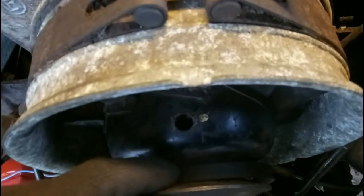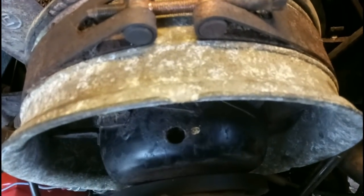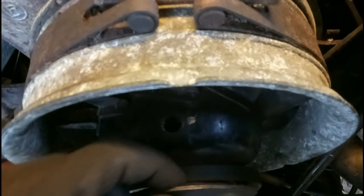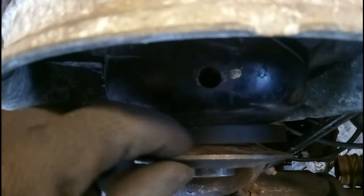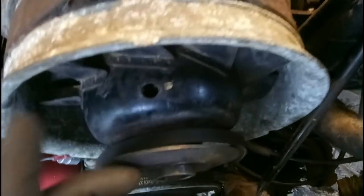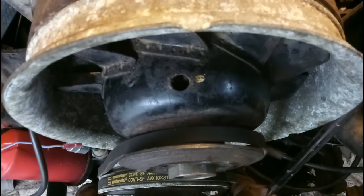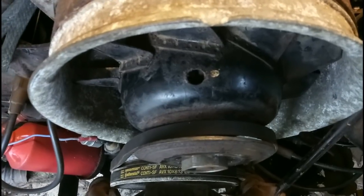So I've packed that full of shims. I need to take shims out and that will allow this pulley to get closer to the fan housing. It'll shrink up. It's a V section - that'll make the belt ride higher and increase the tension. That's how it works. So I should take out my shims and have another go.